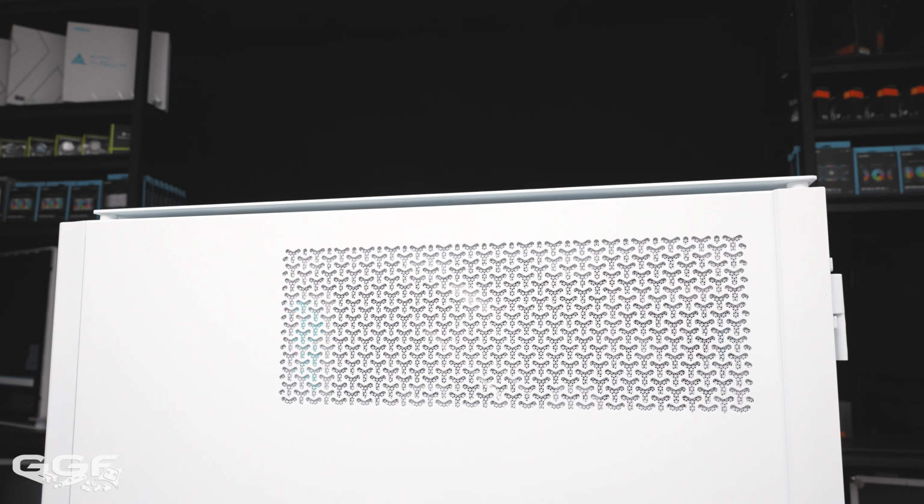One thing I do want to cover regarding the secondary ITX system: the front IO for the chassis is now one USB hub with that single Type-C. So I've plugged one single Type-C in, and that has connected all the USB and all the audio through that hub. If you do run a secondary ITX system, you will lose any front USB with that. Normally when you have dual systems, you can split up which USB you want for your system. You have normally two USB-A for your primary, two USB-A for the secondary, and then you split one Type-C for each one. But now being dedicated for the primary, you will lose that. You could plug that into the secondary and you would have no primary, but you can only have one or the other.